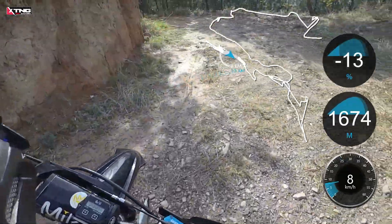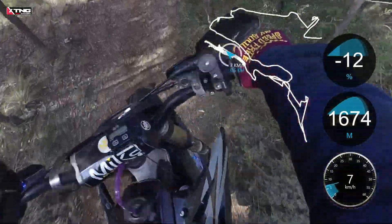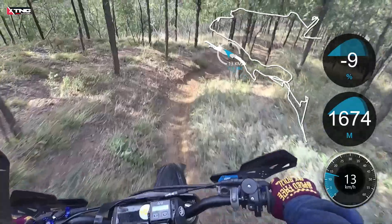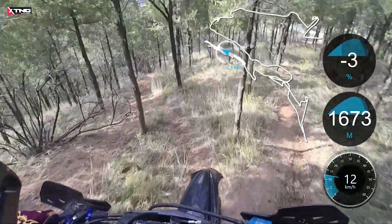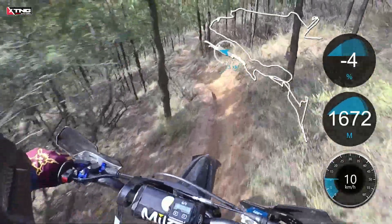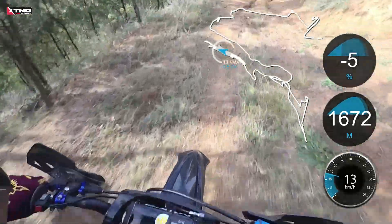Now, let's start testing the torque performance in second gear. The current carb settings are as follows: metering rod X-23, metering rod length at factory setting, power jet at factory setting, torque gain one turn. The altitude, slope, speed, and other information shown on the screen are GPS data from a Garmin camera. This data is not authoritative and should be used as a reference only.